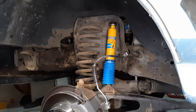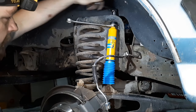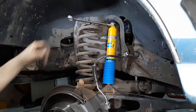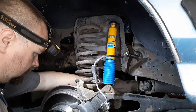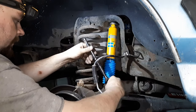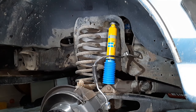That was a 17 and a big wrench. Now that the threads have been cleared up just a little bit, this should go on a little easier now. Last, we put this nut back on. There we go. At this point, we're ready to reinstall the wheel and our shocks are done!